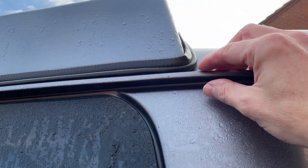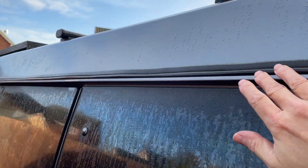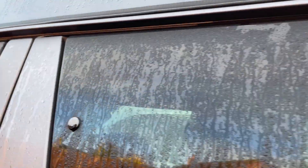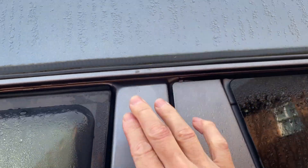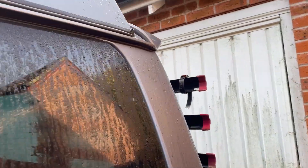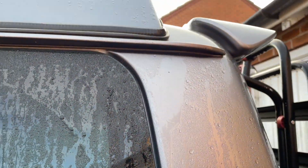The idea is to mount these onto the gutter — that's the normal way. But as you can see I've got an aftermarket roof which sits directly onto the gutter. The original AFT roofs sit above it so you can buy normal brackets for those, but with this roof it's not possible. There are a couple of places to put brackets — one on this door pillar and one at the back — but there's just not much room, so it has to go on the gutter.